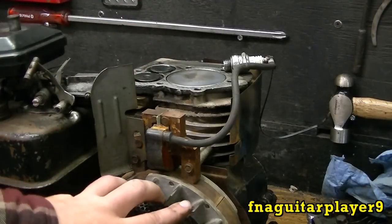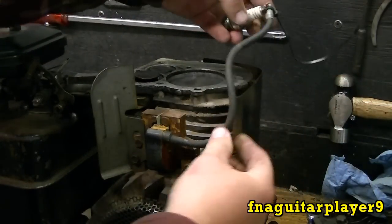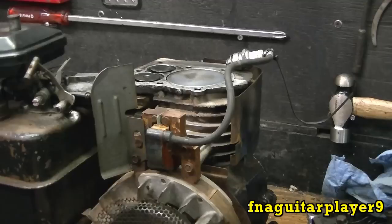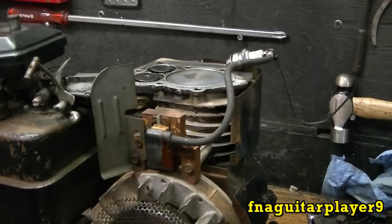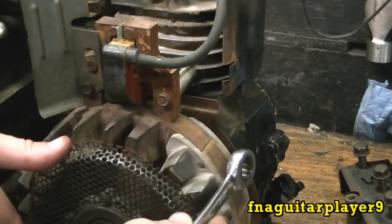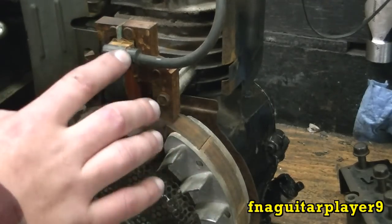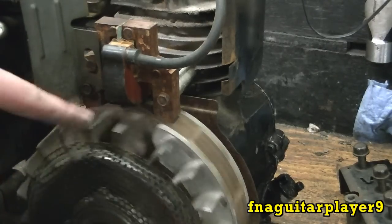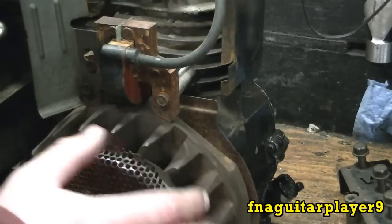Now for the ignition system — follow your spark plug wire back and it goes down to your coil. I'm guilty of calling it a coil on a small engine, but it's actually a magneto, and on newer engines it's called a magnetron because it's all electronic ignition. This engine still has points and condenser under the flywheel. On the flywheel you can see a set of really strong magnets. Small engines don't get power from a battery to fire the spark plug like a vehicle engine. Instead, every time these magnets fly past the two posts on the coil, it generates a charge with enough voltage to fire the spark plug.